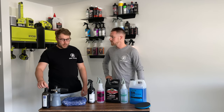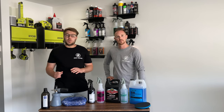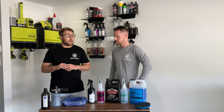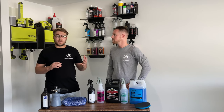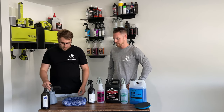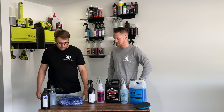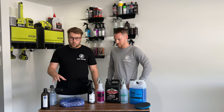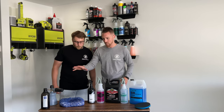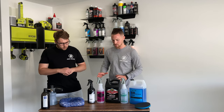This was a really fantastic soap — you could tell it was doing a good job pulling everything off because the water was just sitting on the paint, meaning we had removed a lot of those waxes and had a nice bare surface ready for the decontamination phase. We used the MTM foam gun mixed with that soap and the Microfiber Madness mitt — that combination worked really well to prepare our surface for the chemical decon stage. Once finished with the wash, we rinsed the vehicle completely and moved into a two-stage decon process.